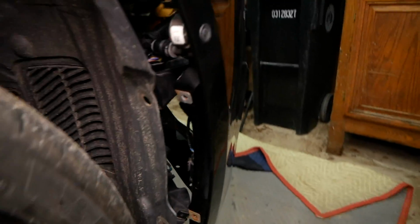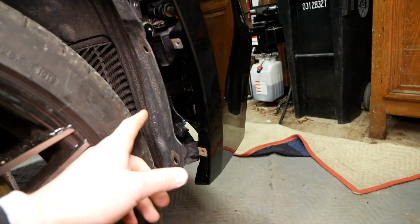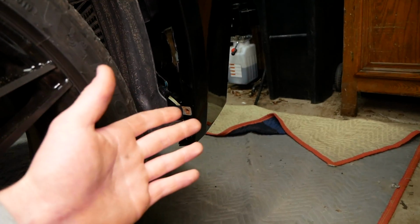So coming over to the passenger side here, we need to take care of reconnecting our headlight washers, our surround view camera here, and the park distance sensor connector down there. Now recall that I did say I was doing a fog light delete, so I'm probably gonna electrical tape over the fog light connector as we won't be connecting it to anything.